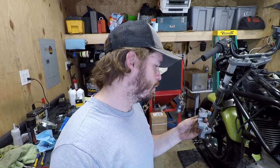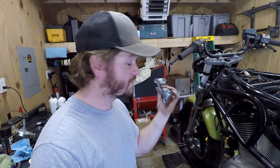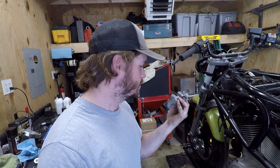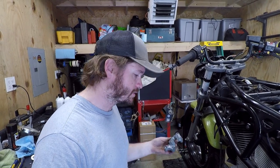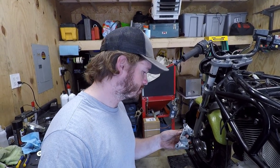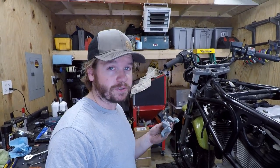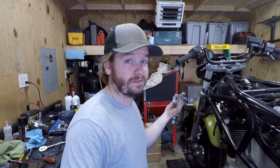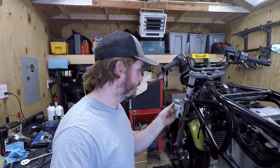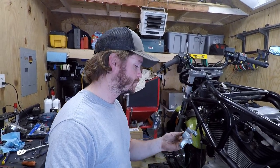It's kind of roached in every hole. They took a drill to it and it's just pretty chewed up, and then it's getting real thin in some areas. So I'm definitely gonna have to look at replacing this, unfortunately. It is what it is, kind of sucks, but if there's ever an instance that I can try to use my counterbores and square these holes up, right now would be that time. It's not like I can mess it up further, but I would feel much more confident, obviously, having four bolts holding the bars on versus three.